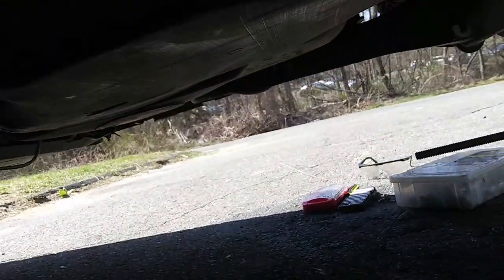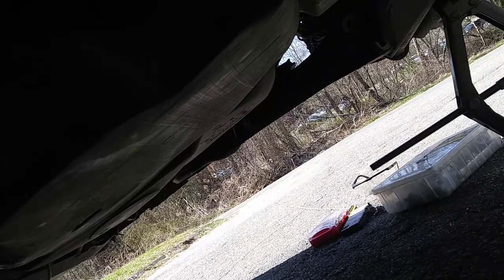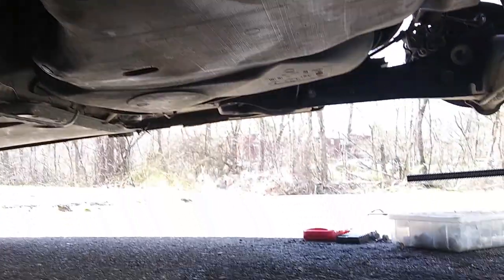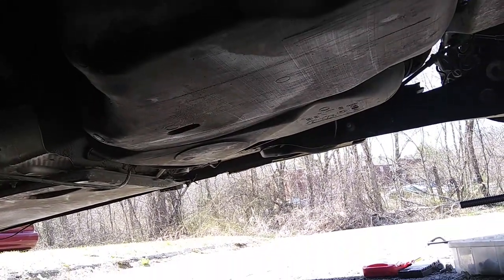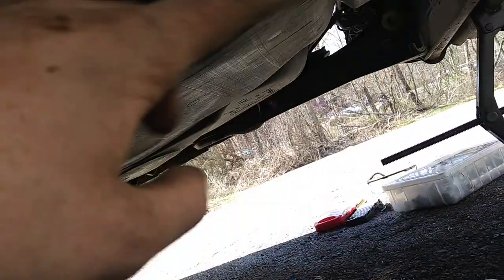And I'm thinking of actually cutting this tank and splitting it, or installing a new tank, which would consist of a fuel send. And the fuel send will send from a fuel pump, and there will be a pump that will loop between the two constantly to help circulate gas. So I'll have a split tank system, and that way I'll have a main tank and an auxiliary that I'll be able to dump into this tank.